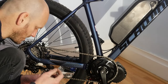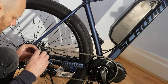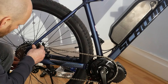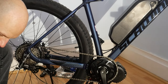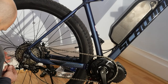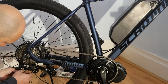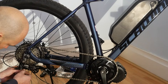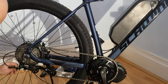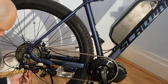I cut off the frayed part and was able to salvage this. Just feed it in there, find it, go clockwise, and give it some steady pressure — hopefully it doesn't splay out. This will just fit in that little ferrule. Sometimes you've got to trim the housing that goes through, and then you'll have to reset up your shifting, which is not very difficult — I'll probably have a video on that. It always helps to have your barrel adjuster all the way in so you have room to adjust. Make sure it's in the highest gear, then keep pressure on it and tighten it up.